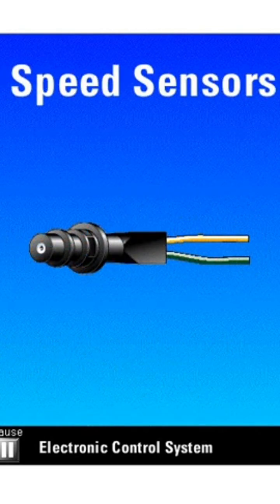The fourth type of sensor is a speed sensor. The speed timing sensor has a permanent magnet and a coil of wire. A change in the magnetic field of the sensor induces a voltage into the sensor. The ECM reads the increase and decrease in voltage as a signal.